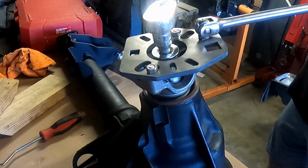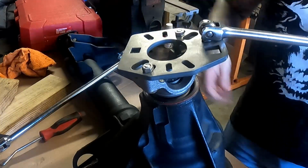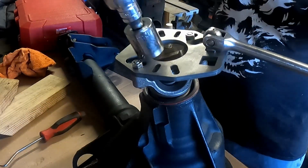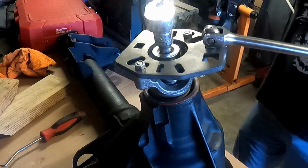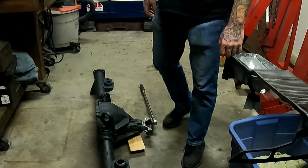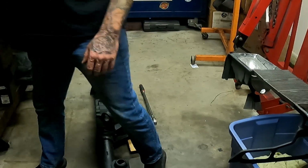All right, once it tightens, let go a little, and then make a few little checks. This is just kind of finessing here. All right, still not enough. You do have to crush the collar a bit first. Okay, because this crush collar is not crushing easy, we're moving on to, gotta go a little more barbaric.